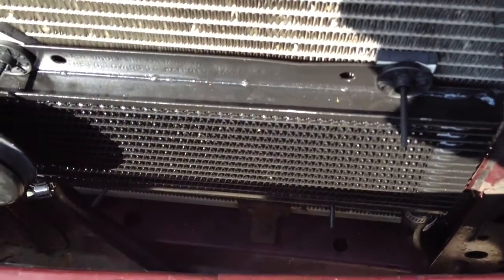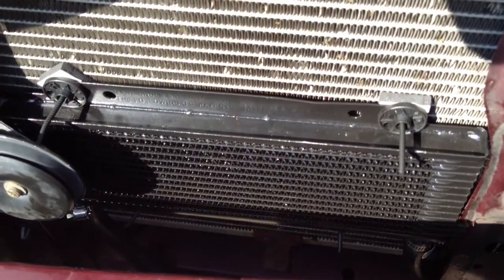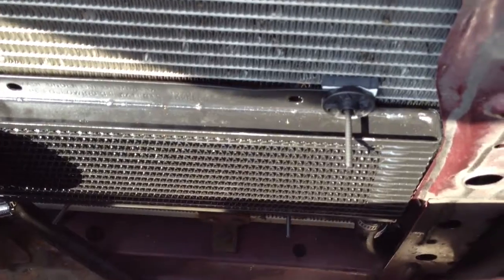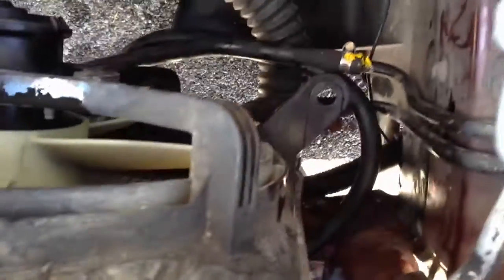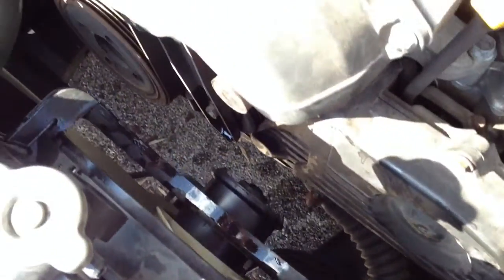Here it is mounted to the front of the condenser for the air conditioner. I have these little push-through style zip ties installed behind and through, which I moved the radiator out of the way for. I could have just punched the thing all the way through the radiator, but I wanted to maintain the ability to remove the radiator for service such as timing belts, water pumps, coolant flushes, etc.